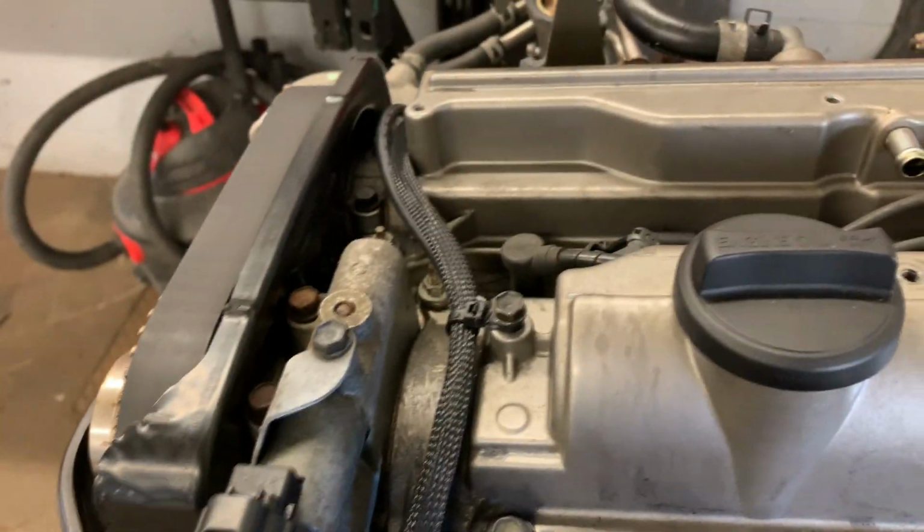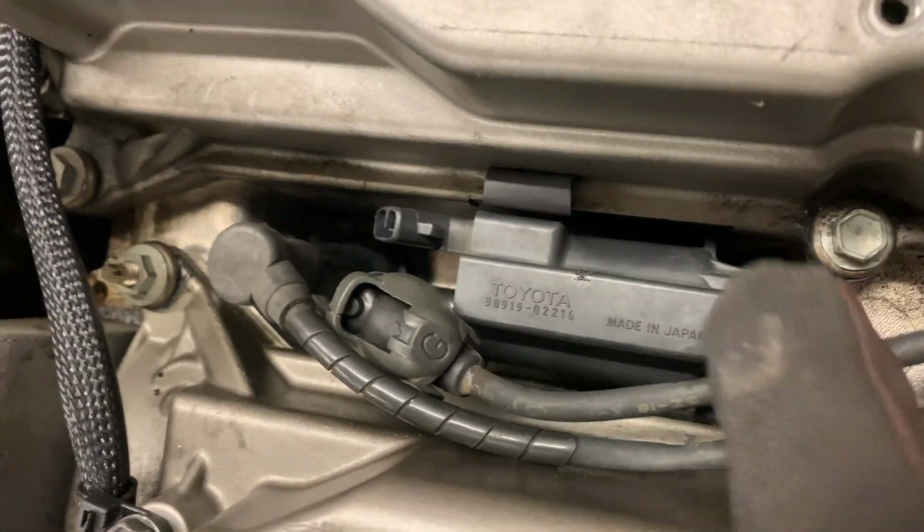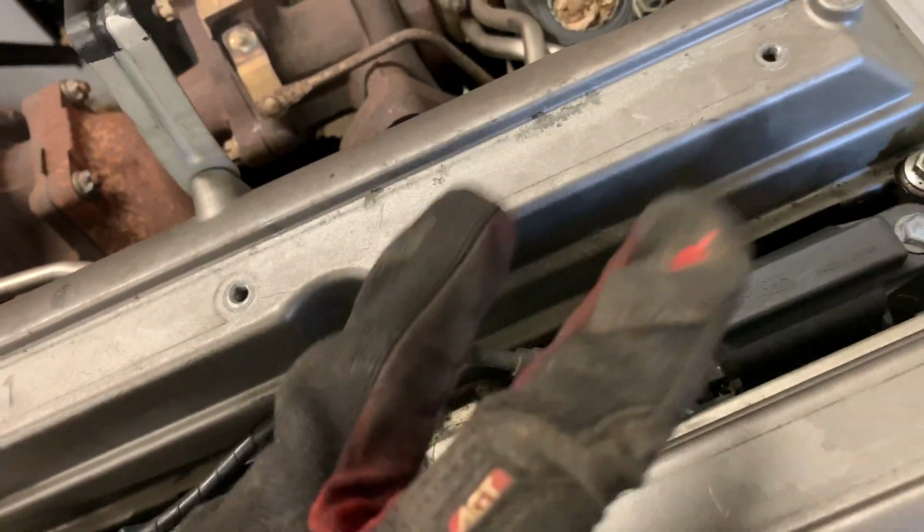Right now, I'm just trying to debate whether I'm gonna go Toyota Yaris coils, like a single coil conversion, because this is wasted spark. For instance, it connects right there, sits directly on top of a coil, fires that coil, then it has a plug running from this actual coil pack over and runs that one as well. So each coil runs 2 plugs. No bueno. Because I don't want this igniter. This is literally a harness for the coils because of this igniter. That's garbage.